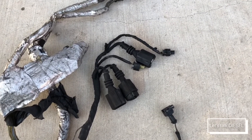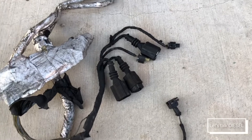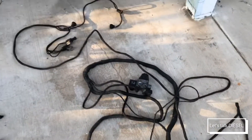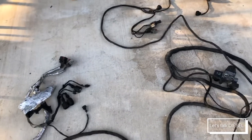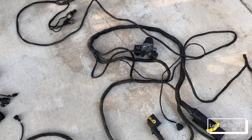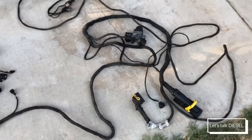As you can see, there are so many parts on this harness. In the newest Cascadia models they've already changed this — it's no longer designed like this. The issue with this one-piece harness is: first, you have to be very careful with your blade when opening the tape; second, if something is wrong you have to replace the whole assembly — you can't just replace one section.